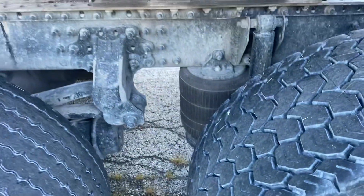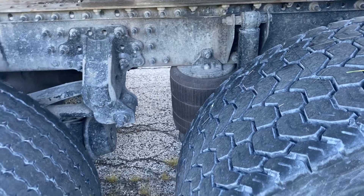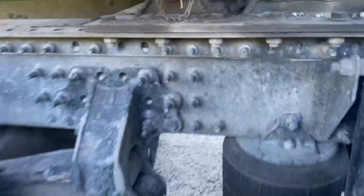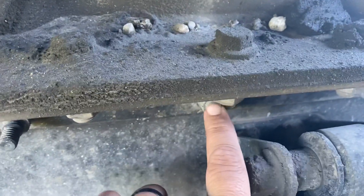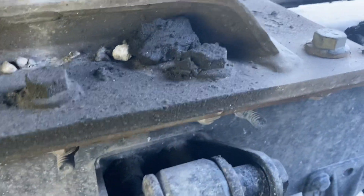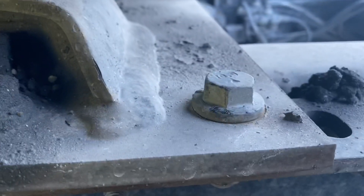When you're walking around in the morning, kicking the tires, checking tread, also be looking for — what do I always say — dry powdery rust. People ask me, 'Hey, what do you look for on these bolts?' See how all that dirt and grime is compacted in there around those bolts? That's a pretty good indication those suckers are on there good and tight. But look at this lead one — see how it's kind of pretty clean around the edges?